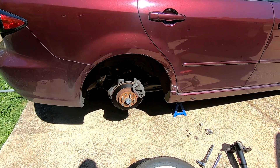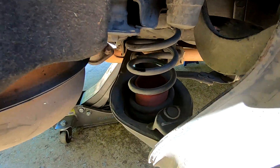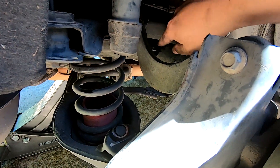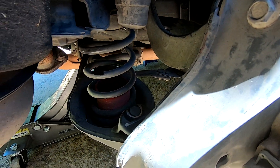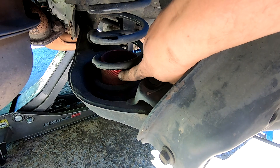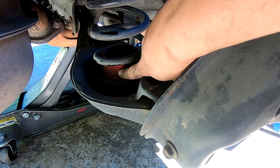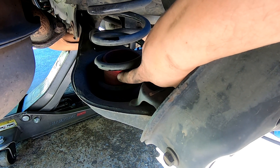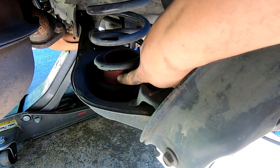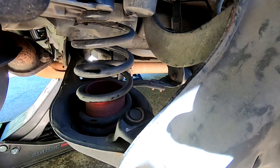Before we do that, let me give you an overview of the other issues I've had with the back. This is a coil spring and you normally have a shock absorber right here, which is out right now because it just broke. The buckets they send you - this red piece - does not go low enough. I actually had to modify these, and I'd love to take it out and show you the modification but I really don't feel like doing that right now. I'll try to put a picture on screen.